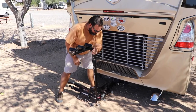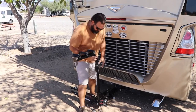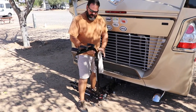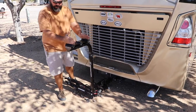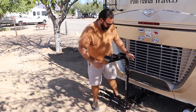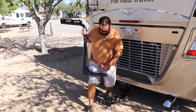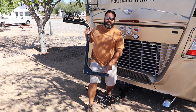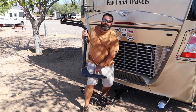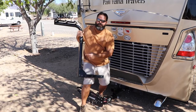And then you've got the upper tube right here for the bike rack. We went to Camping World and got the bike rack too. One thing about it is it kind of stuck out a little bit too far, so when I have the bikes mounted on here, the truck is right over in this area — it's a little bit tight. So I modified the bar a little bit. The mounting pin hole was way back here, but I drilled a new one way up here, so the bike rack slides further in, giving me more clearance between the bikes and the truck.